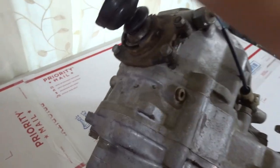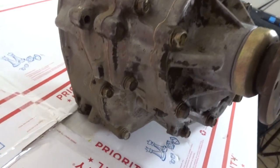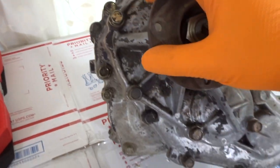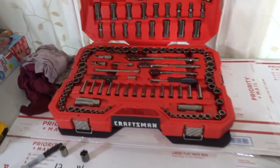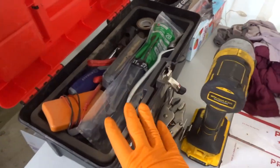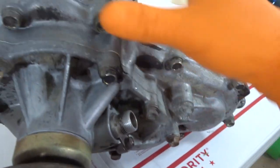It's already been cleaned out so all the oil is drained out and all the outside has been degreased. We're going to break it down and have some fun. I have my whole Craftsman tools, my impact, some other tools, gloves, and Ziploc bags — this is for all my bolts. Make sure you label all your bolts, which bolts go where in each cover.